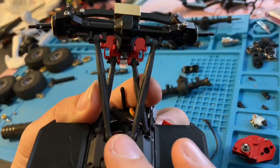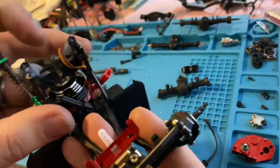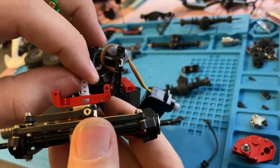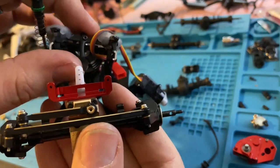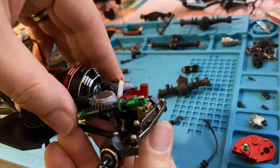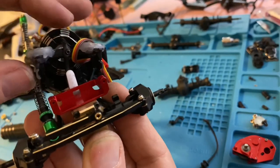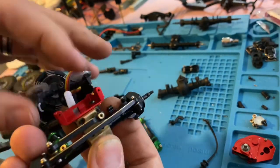There we go, we're all installed. You can see that it's much more even, and we've even got our limiting strap mount. We can mount our limiting strap anywhere on here. We'll probably end up cutting this down — we probably only need the third hole here, just because I don't want it to bottom out. We might even end up needing to mount it to the fourth hole from the backside and cutting all the rest off. We'll have to see.